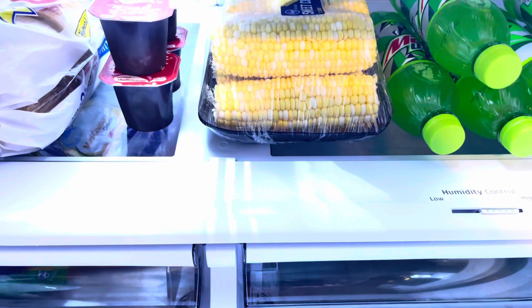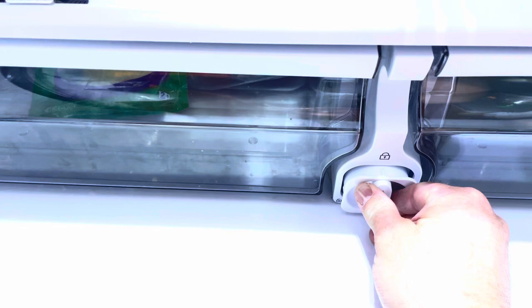All you're going to do is just turn this out a couple of times and pull it straight out. Now you're going to have a little bit of water coming out of this — as you can see, I put a dish in there. I have a few droplets here; that's fine, you can wipe it up in a minute. All you're going to do is take your new filter, push it in, and just keep turning it until it locks in place.